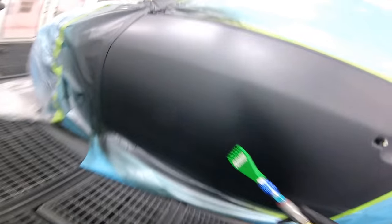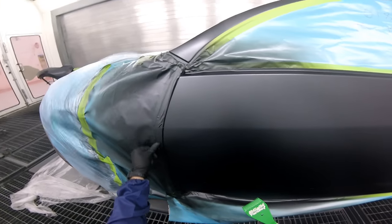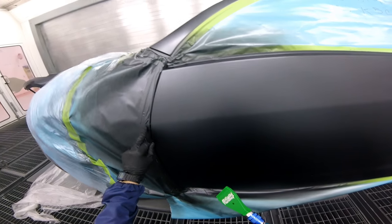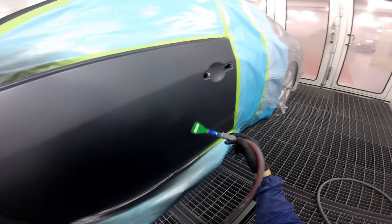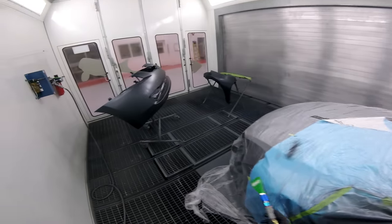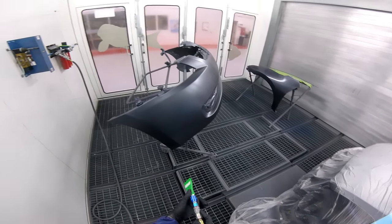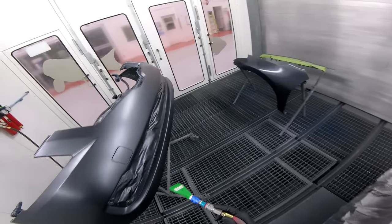I'm leaving this drying phase in because I want you guys to see. I didn't really walk out of the booth — I just sprayed it in the booth. This video is 20 minutes but obviously it took me longer. The base is dry there — it was wet and there was a wrinkle in the tape. You want to make sure that it's dry because if you don't, you will have die back, you will have problems. And you don't want this car coming back.